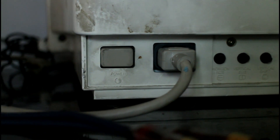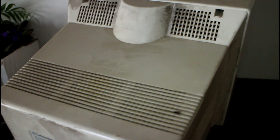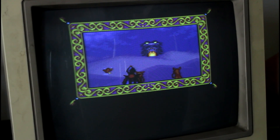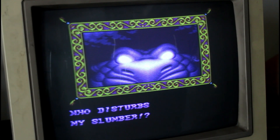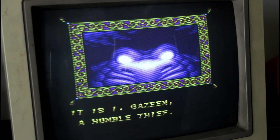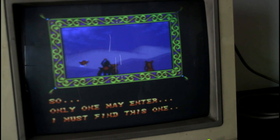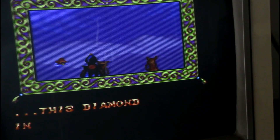The power button clicks but won't stay on, so you have to hold it — that's what's getting replaced. The screen is dirty too, not giving the monitor any justice for how good it looks. The scan lines look awesome, the color is correct, and I don't see any geometry issues or warping. It all looks really good, which is amazing considering how disgustingly dirty it is. I was surprised it even turned on. So a power switch replacement, a good cleanup, and a polish of the dirty glass and I'll have a nice CRT gaming monitor. I'll definitely make a video on the cleanup and restoration. It's going to involve a lot of scrubbing, some Retrobrite, and some soldering — the switch is soldered to a PCB. I'm not amazing at soldering, but hopefully the solder points are big enough to make it straightforward.